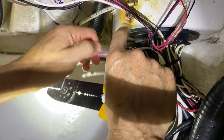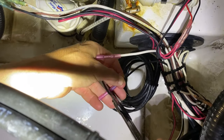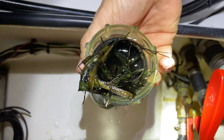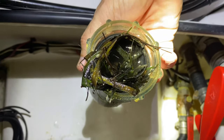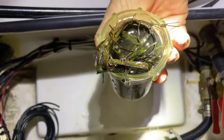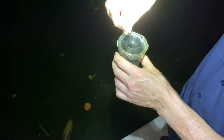Give it a pull — yep, doesn't come off. We're looking at the strainer and it looked kind of green from the outside. After pulling it off we could see why — it has a green hue because it's caked with seaweed. Definitely some negligence on my end; I've probably never pulled this off to clean the strainer. Now we know for the future — let's get the spinach out of here.